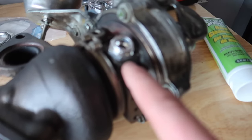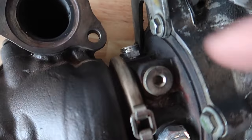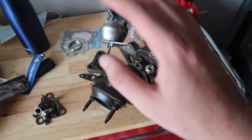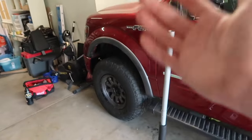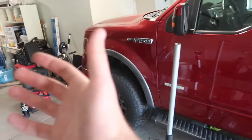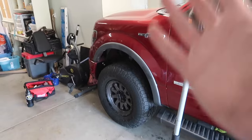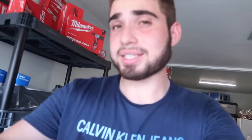I'm just happy we got these two pieces on — this is the stuff that's leaking, the coolant lines. We got that one on there and that one over there, so we have brand new coolant lines. This thing should be perfect when we put it all back together. Thankfully on the left-hand side you don't have to remove as much. On the right-hand side you actually have to remove the starter and the steering rack, so luckily it looks like it is the left-hand side. Hopefully the right-hand side is not going out anytime soon.